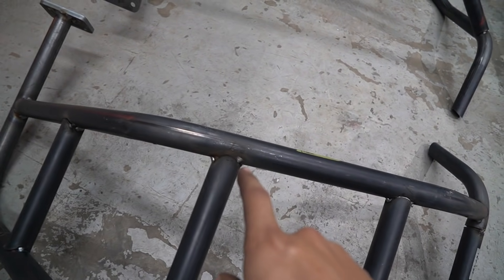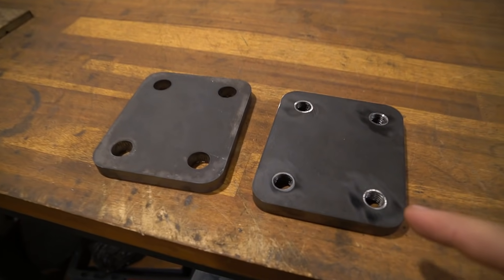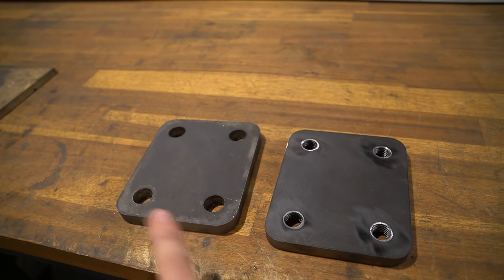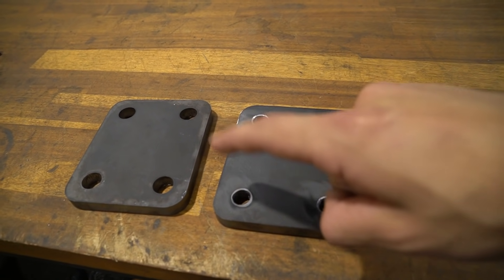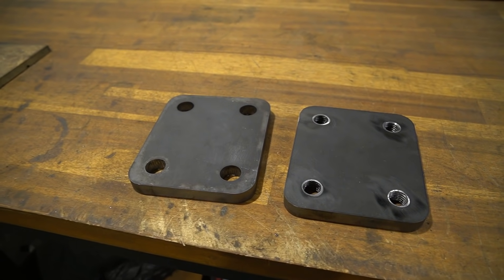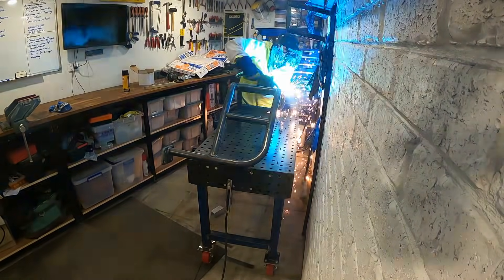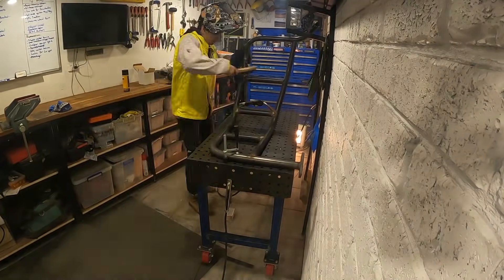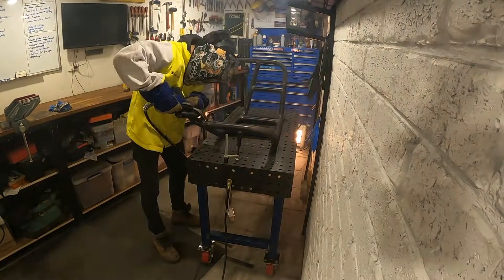We've just left them tacked but I can fully weld them off at home. Remember how I told you there was no CAD or laser cutting in this episode? That's a lie — I actually got these laser cut. So these are chassis mount plates. The outer has a clearance hole for an M14 and the inner is an M14 by 2. This one's welded to the chassis, this one's welded to the guards. I've also got a triangle design as well which you'll see later. I installed the front guards but wasn't happy with the position, so now I'm going back to do the rear ones first to get a better reference.